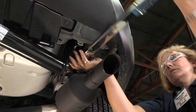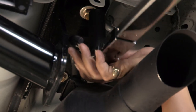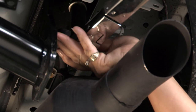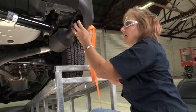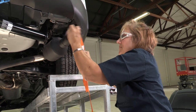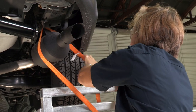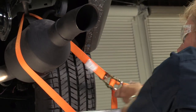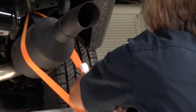Again, you want to make sure you torque it until it pops. We have to get the muffler to move out of the way, and I don't have anybody to assist me, so we're going to use our trusty ratchet strap. Wrap it around and ratchet it so that it pulls the muffler over here out of the way, giving us enough space to get the impact tool up in there.